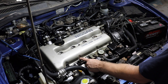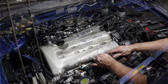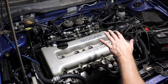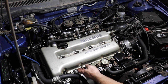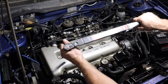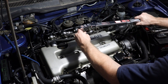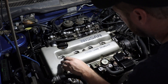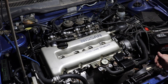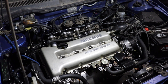All you need to do now is put those nuts down in the rubber grommets with brass caps and tighten them to spec all the way around the valve cover. I like to start from the middle and work my way out. Having snugged everything down, it's time to torque everything to spec — seven foot-pounds of torque, that's it. I've got a three-eighths inch Snap-on clicker-style torque wrench, and you're going to go ahead, again starting with the middle, and work your way out for all your bolts. As far as the valve cover gasket goes, looking good. That should stop our waterfall of oil leaking over the entire block.